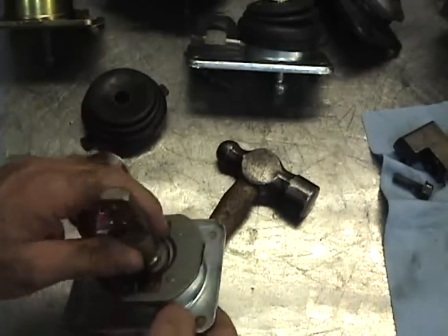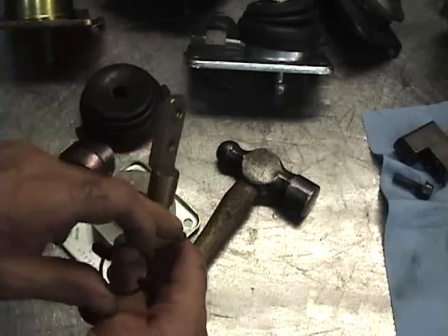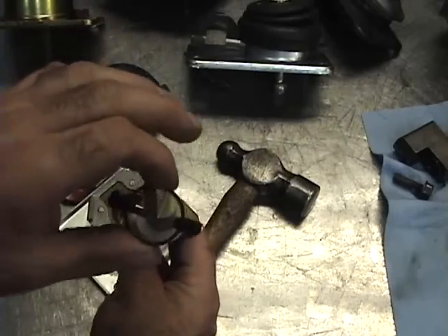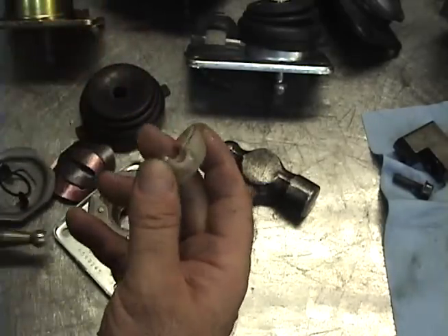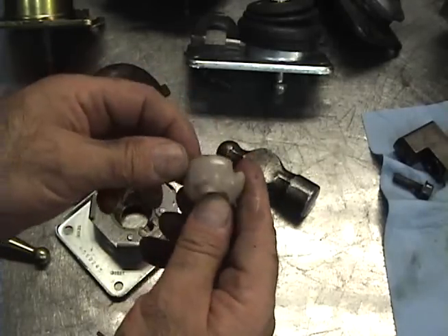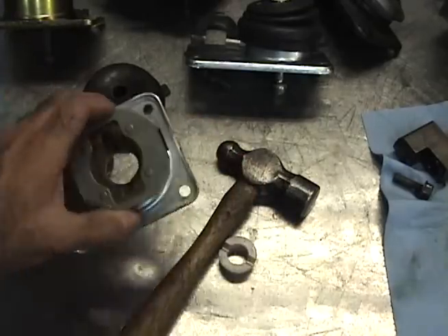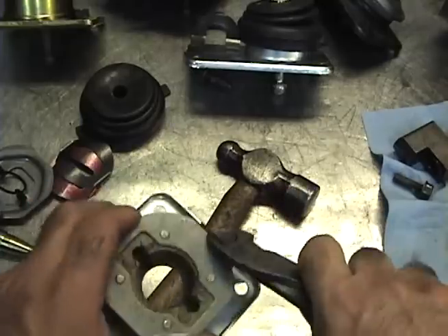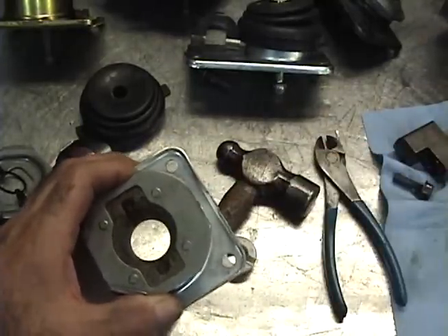You're also going to have this little plastic piece that protects the cross rod — it fits on there like that. And then you have the half-circle ball socket piece, which is kind of a Delrin material. What we do is take this little piece and cut it off, and then go back to the grinder and clean it up a bit.